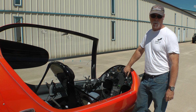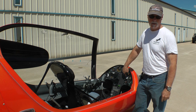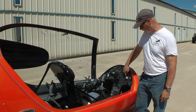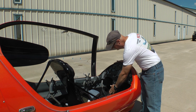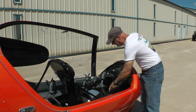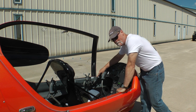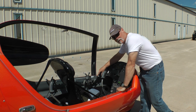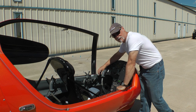This white gauge is going to become important to us: trim is pneumatic, and this tells me how much pressure is in the system. In a normal airplane I'm looking for a pointer or lever position; in this aircraft I'm trimming by pounds or bar depending on which scale you want to work off. Then we have our electric panel — mag switches and key start. The only difference is the mags in this aircraft are on toggles instead of being built into the key start. Because it's a Rotax, we have no mixture, so we have a choke. It's a little bit like starting your snow blower or lawn mower. As the engine warms up, we take off the choke. The Rotax series, if carbureted — which this one is — has altitude compensating carburetors, so we don't need a mixture. We've got a beautiful day, let's go fly.